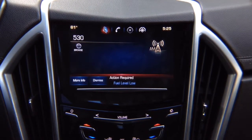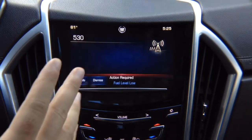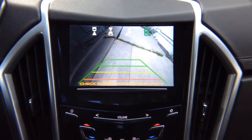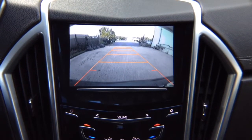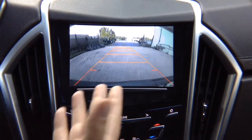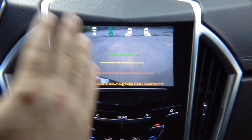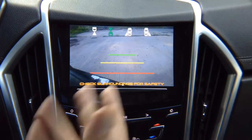Let's say you're driving. With the left turn signal, you will get the left camera. Keep in mind if you didn't install a left camera, nothing will turn on — it will be as before. Put on a left turn signal and you get your left side showing blind spots. Right camera switches automatically to the right side; if you didn't install a right side camera, nothing will switch. In reverse, you get the factory rear view camera — if your car isn't equipped with one, you can add one. In drive, you get the front view camera, which shuts off automatically after 10 miles per hour.